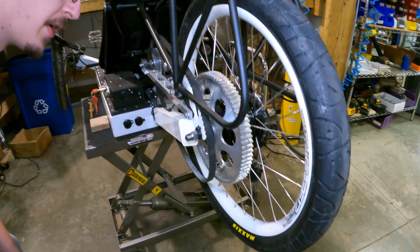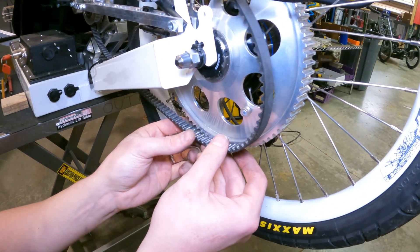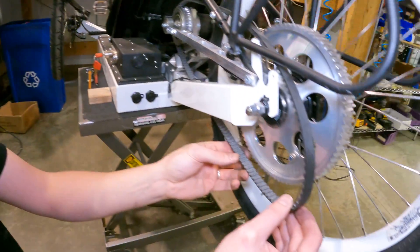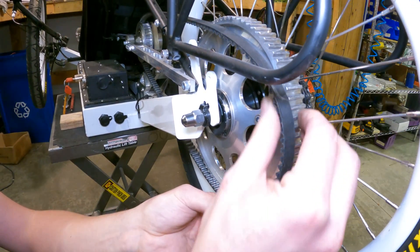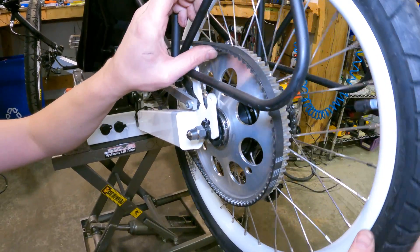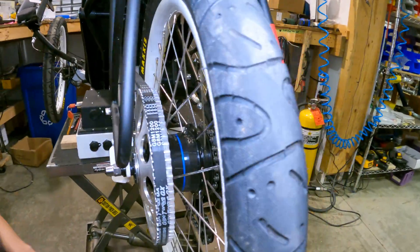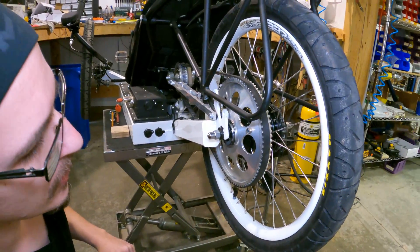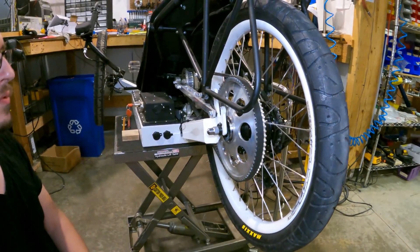Now to get the belt situated again, we'll take from the bottom and grab just the edge of the belt. First, make sure that this is sitting on the front pulley in between those two flanges. We'll take from the lower end, situate that in the teeth, and just start to rotate that wheel. With a little help up here — there we go. If you rotate it a couple times, our belt is now situated. As long as it's not sitting proud of the pulley, you're fine. These frames do vary a little in how the pulley alignment ends up, but being nearly flush is perfectly acceptable. And with that, the rear wheel is reinstalled.